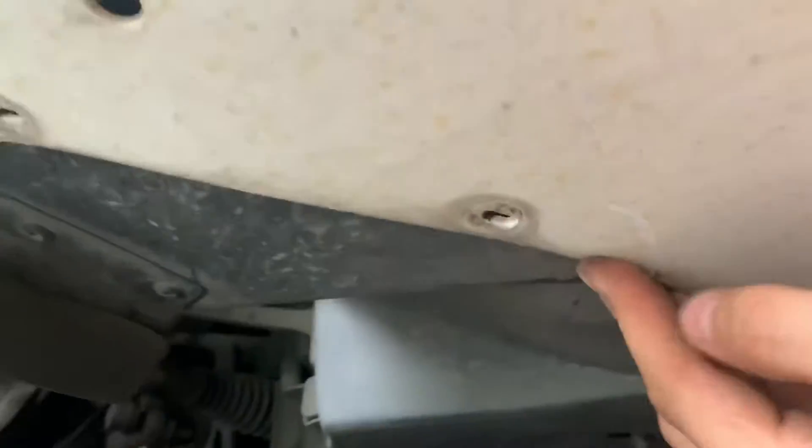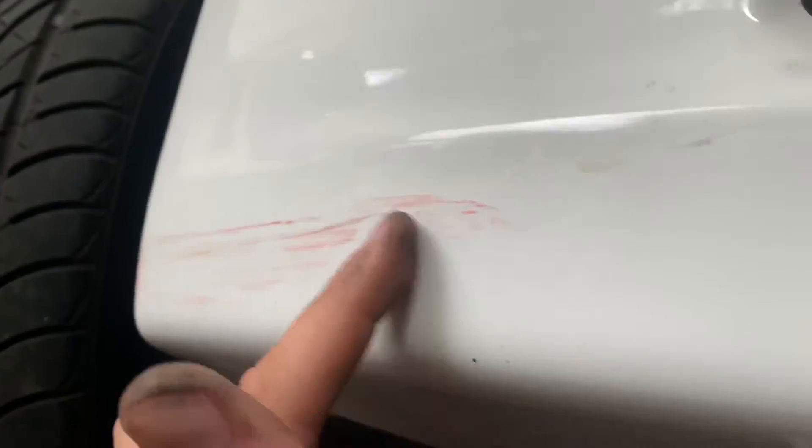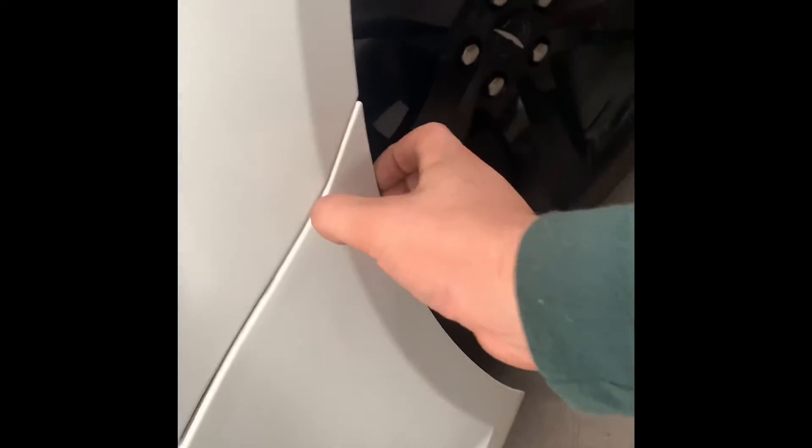You'll see there are clips — it slides in there and you can easily pop it out. Here's the current progress: all the bolt tools in there, all you need, and a screwdriver. Here's the scary part everyone hates — you've got to rip this out and the bumper's going to drop. It's a one-man job but you're better with two. Just pull it — you feel like you're going to break it, but don't worry, you're not.